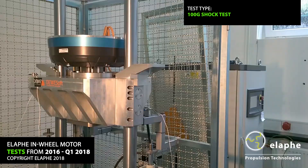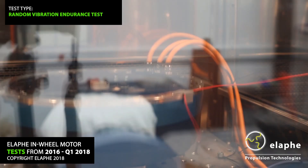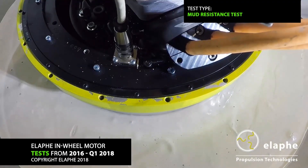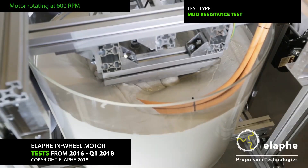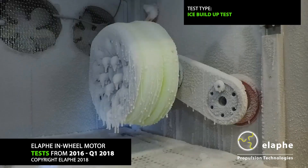What were some of those challenges? It seems easy — just put an electric motor in a wheel and you're done. But what have been some of the technical challenges to overcome? This is exactly the challenge — you should not look at it as an electric motor, it's a chassis component. You should look at it from the chassis component point of view. It has to fulfill very tough requirements in terms of vibrations, shocks, environmental influences such as temperature from the brake, as well as water, mud, and these kinds of things. So those all make it a multi-physics problem.